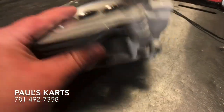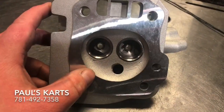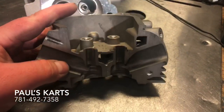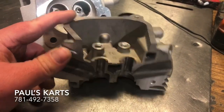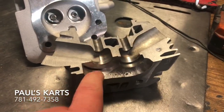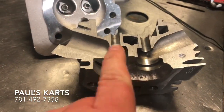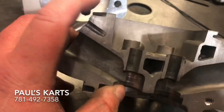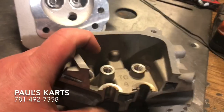This is a brand new GX 200 casting. I have thousands of them around here, and I had one hanging on the wall for the longest time that I had chopped up. My buddy came in the shop and said that's the coolest thing he ever saw. But this was just a bad casting. Anytime I was putting in bigger seats I would use it — adjusting the counterbore, drilling into this head to find the right size before putting the seat into the proper finished head. So this is just a test dummy.